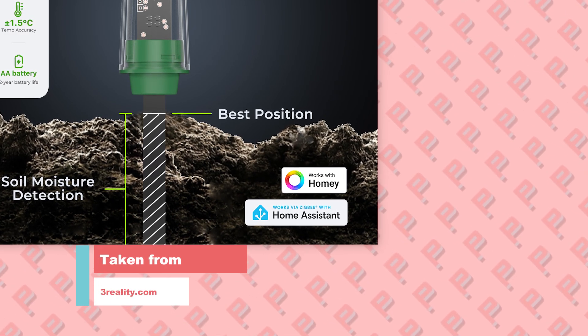This also means you can use the watering kit without any smart home platform at all, relying purely on the internal clock. It's a different story with the soil moisture sensor. On SmartThings it hasn't dropped out after a week and seems stable. On Home Assistant, however, connected via ZHA, this sensor keeps dropping out — repeatedly after a couple of days it terminates the connection, though it reconnects without problems when you try. It keeps falling off Home Assistant.